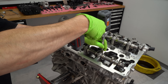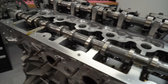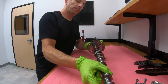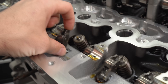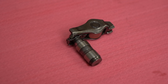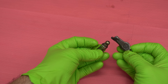First I'll pull out the exhaust cam. We'll pop up the exhaust caps — this is also where the mechanical fuel pump stand is. You can see all the cam lobes, and one is a little different with three sides to it: that's the lobe that pushes on the mechanical fuel pump, pumping three times every camshaft revolution. The rocker arms sit under the camshaft and pivot on hydraulic lifters, so these engines never need a valve adjustment. One thing I really like is these rockers have a small spring clip that keeps the rocker from falling off the lifter at really high RPM — we've had problems with rocker arms falling off in racing with other engines, but this should hopefully solve that.